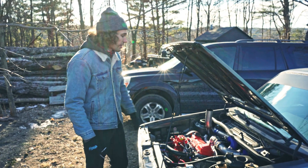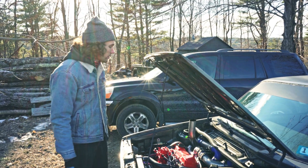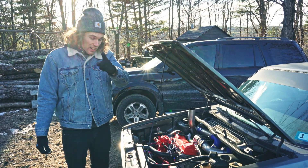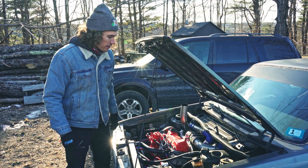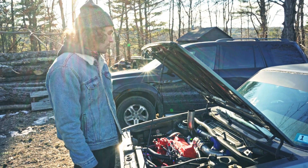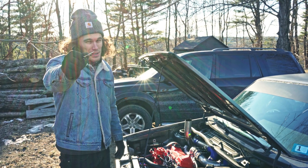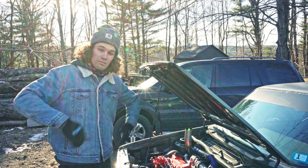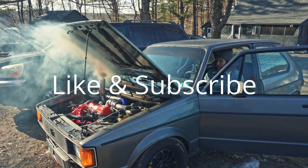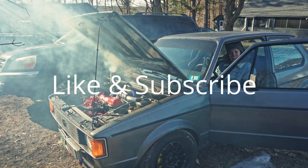Here we are back. I literally thought we broke the manifold, because I had this problem before with compounds on it — when EGTs get too high it blows out the welds, everything snaps and rattles. But it survived that big hill pull, which was cool, and nothing's broken. It is leaking coolant but I think I just need new reservoirs. There you have it — the big single turbo setup. Not bad. We're definitely going to have compounds coming in the near future, meaning like this summer. Thanks for watching!